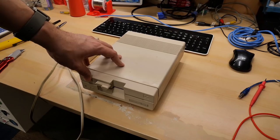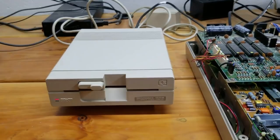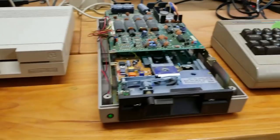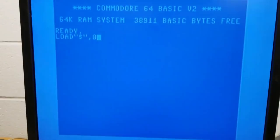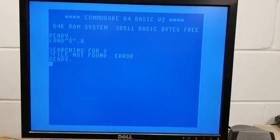While emailing with Eric, he sent me a video of what exactly this drive was doing. In the video, Eric says: 'Here is the 1541-II drive. This is one of two drives that I somehow destroyed by connecting them to a PC with an XE1541 cable. Any diskette - this is a copy of Archon that works just fine in other drives - load this in, simply try and pull up a directory listing. You get a file not found error, and the drive will flash like that with the drive light flashing fast.'